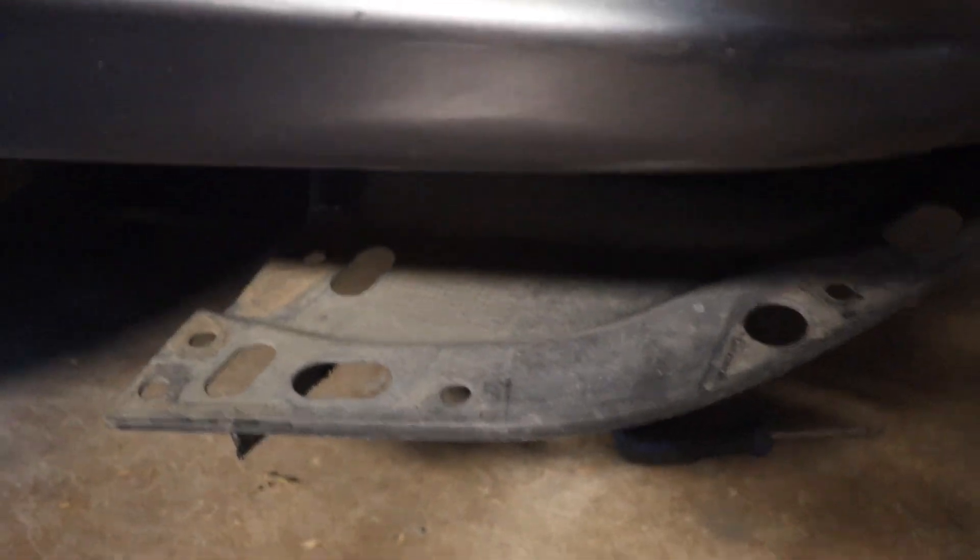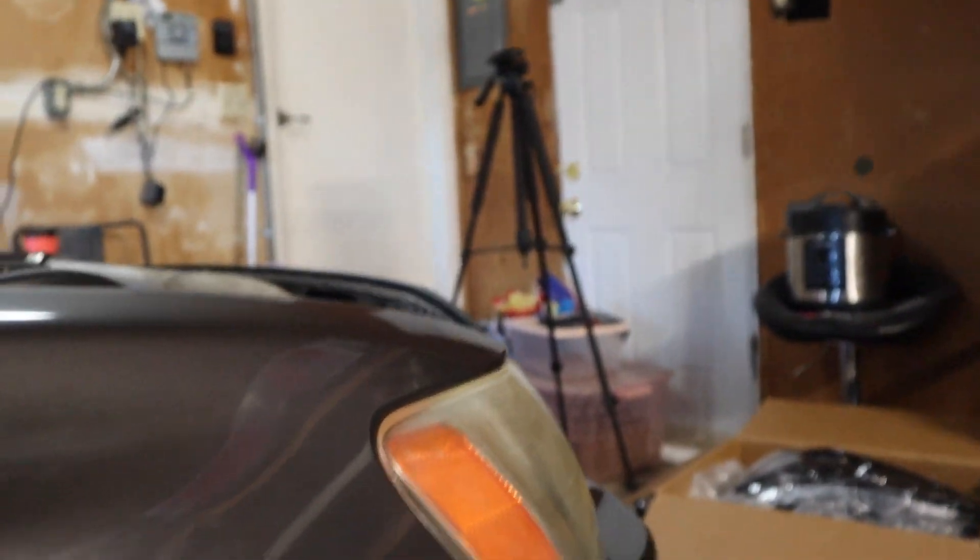Broke a few clips, but that's okay. The last spots we need to remove: there are two 10mms in the back behind the bumper — one on each side. Then over in the fender liners there's one screw and three more little pop clips that should come out fairly easily, and then the front bumper can pull right off.